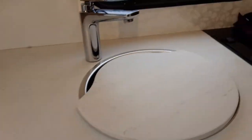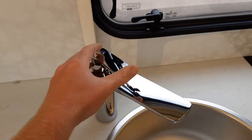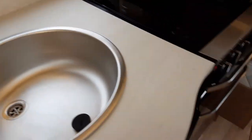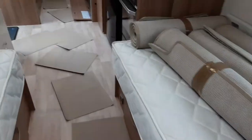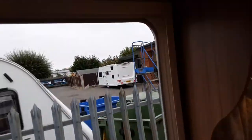Once you've got that valve in the right position, you can then come over to every tap on board the caravan, turn them to the hot side and open all the taps up completely on the hot side. This is still before you turn the water pump on. In the bathroom, you've got the same — open all the taps up, and the shower one as well. I'm not going to do the shower at the moment because the system has already been bled prior to the video being done, but I just want to show you how to do it.